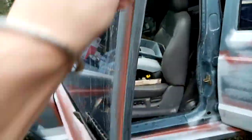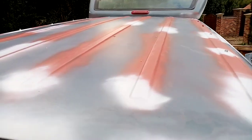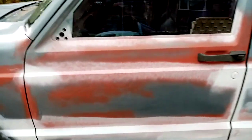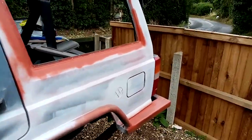Also, it would be good to say: when you're doing this job, if you forget to etch the sides of the paint, door cards, door edges, it's a good idea to run an emery cloth over them. As you can see on the roof, there are no shiny parts at all. If you're getting shiny parts, run the emery cloth over. But if you do happen to miss something, then that Upol Grip 4 is going to save your day — it will adhere to the paint and the paint will stick and you won't have any lifting. Some people go heavier than 180 grit. I've never used it before and I don't want to go any lighter than 240, so I thought I'd go in the middle and go with 180 all around the whole vehicle.